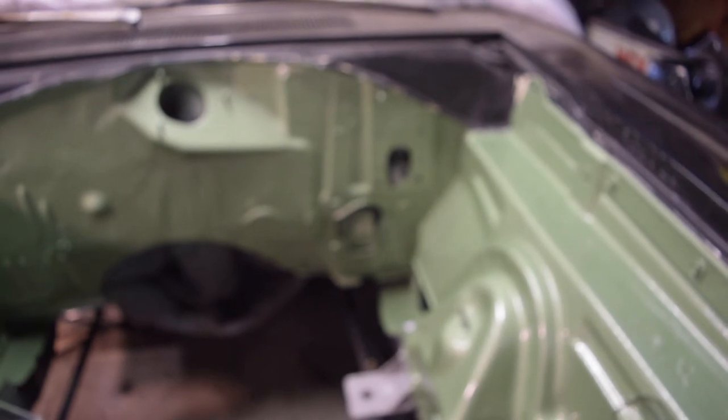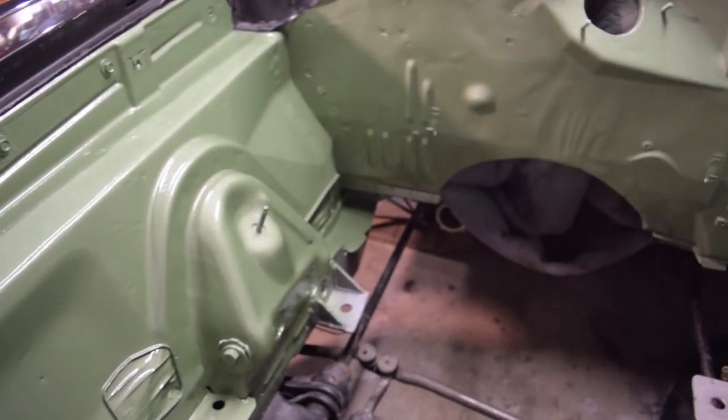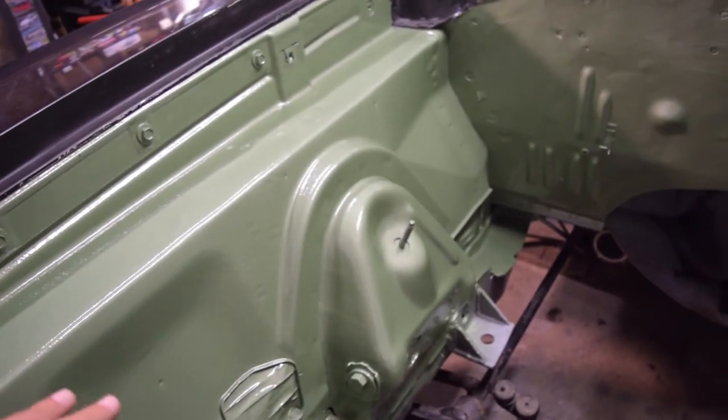Issues with the gun. I think what happened was I have a pressure regulator on my tank, and I thought I had that where I wanted it, which is right around 40 psi to the gun. And then obviously I've got another gauge on my gun, which steps it down from there for the actual gun and the tip itself. But that was actually wrong. When I looked after the fact, I saw that my compressor had been down at 10 psi. So I had really low pressure to the gun, and atomization kind of sucked. I noticed it in my base coat, and actually my prime too, but I just assumed, having not used the gun before, that that's how it worked, which is not the case. So definitely have some major orange peel.